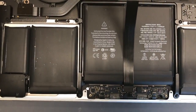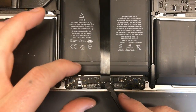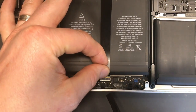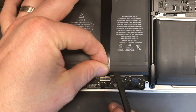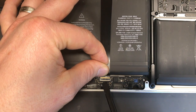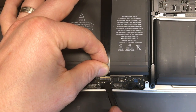Now this would be the hardest part, even though it's quite simple. There's just a little tab here you lift out of the way, and then you can see a flip connector. Get your spudger, put it underneath the flip connector, and just pop it up — and there it's just sitting up.